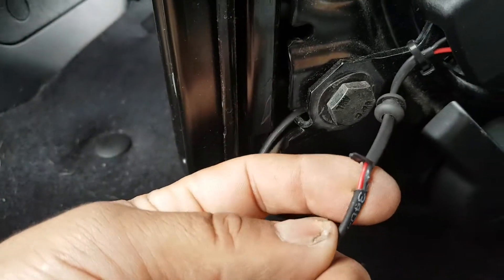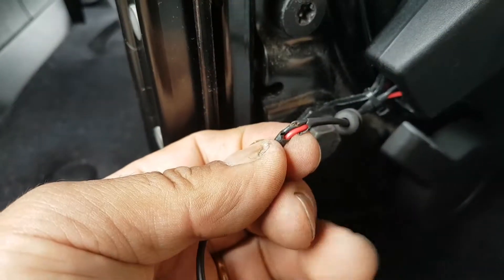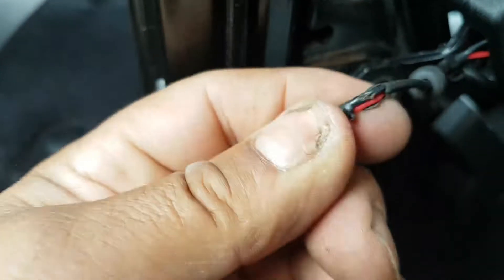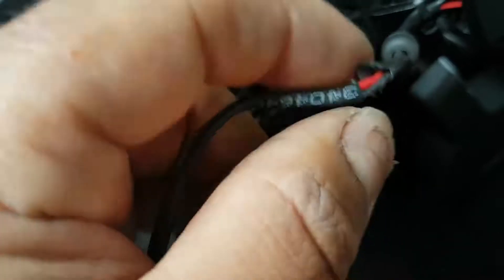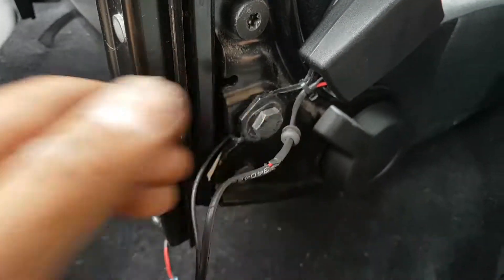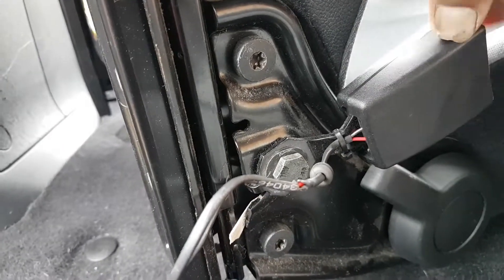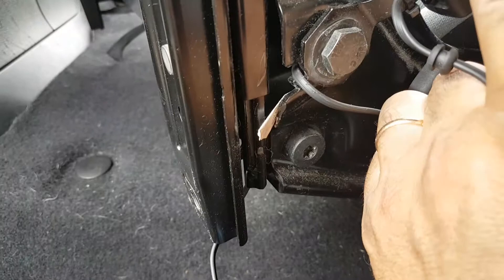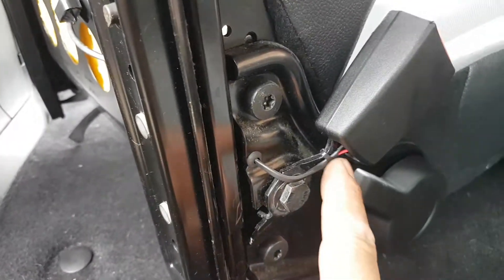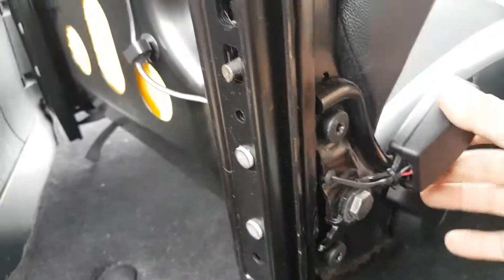The red wire is actually good — there's only the black one damaged. Even if these two wires shorted, the only effect would be that the system would think the seat belt was on when it wasn't, or vice versa. It's not completely gone through yet — only a couple of strands. We're going to isolate this properly, put the grommet in place, and we're done. The cable was being trapped by the seat mechanism as it moved — that's how it happened. This is how the cable should be routed: completely away from that pinch point.